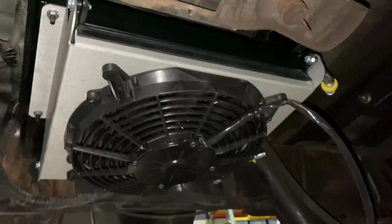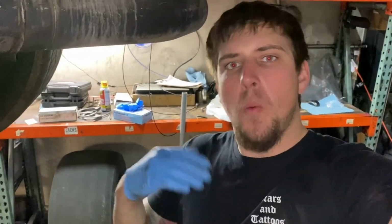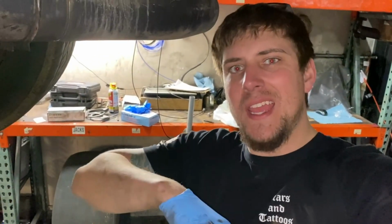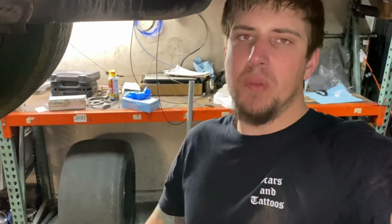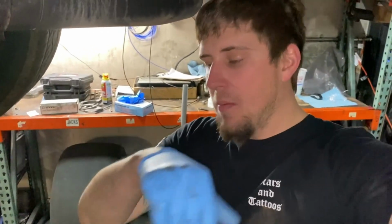So we got the hot retorque done. You guys saw it. I always get this question: I do the overlap method. So you set one in overlap, which means the intake is just opening, exhaust just closed. You do six, and then you just go on fire order 153624. Whatever cylinder is in overlap, you do the companion cylinder lash. So just buzz through it real quick. They didn't move. Cam breaking went smooth because the lash didn't loosen up.